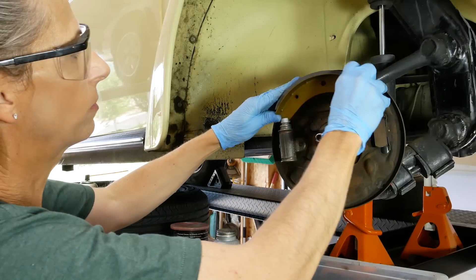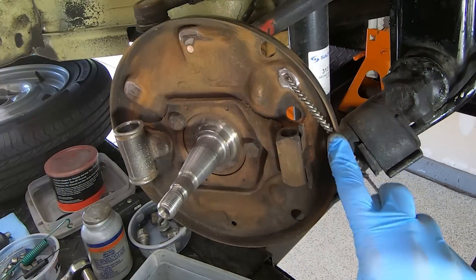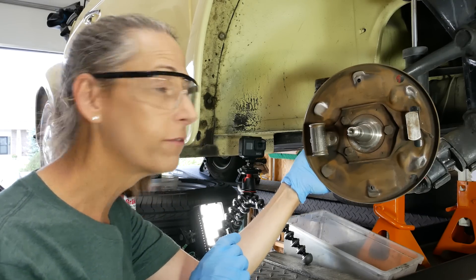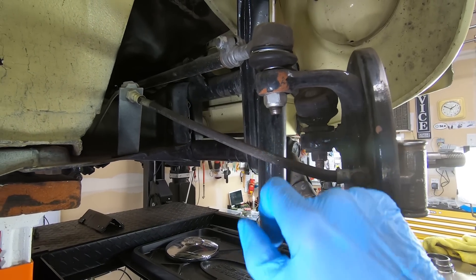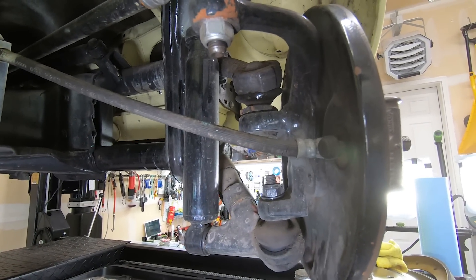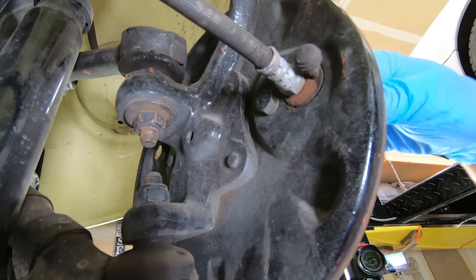You also want to look at where the brake shoe is going to move in and out and find the contact points on the backing plate. Those points need to be cleaned and lubricated. With the backing plate clean, let's get to the wheel cylinder — it's held on by a bolt in the back and we have to take the brake line off. But look at this soft line: it's so tight it's even pulling on the bracket. Underneath there are cracks and splits in the hose itself. This line definitely needs to be replaced.